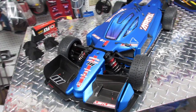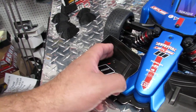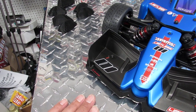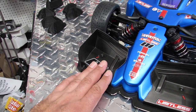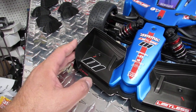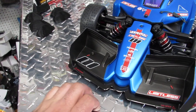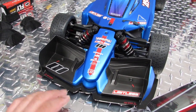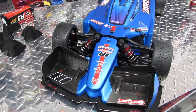For aerodynamic purposes on this vehicle, this corner piece right here needs to get removed. This will not give you the downforce you think it will — it acts like a major air brake. It's important for keeping you straight and maintaining some airflow for the wheel, but it's pretty bad. It's too bad we don't have an air tunnel with smoke to show how this creates such a big turbulence — it's literally like a parachute in front of the vehicle.